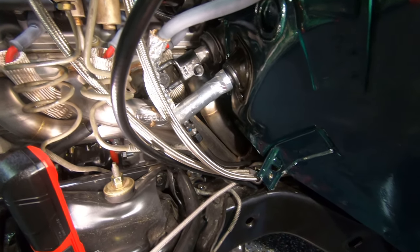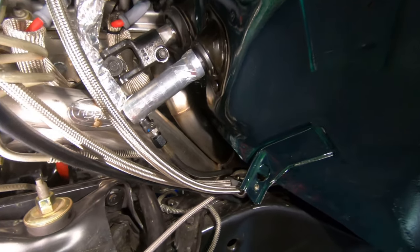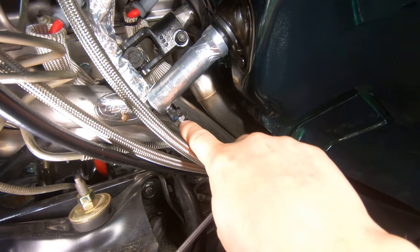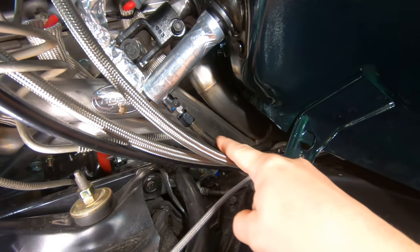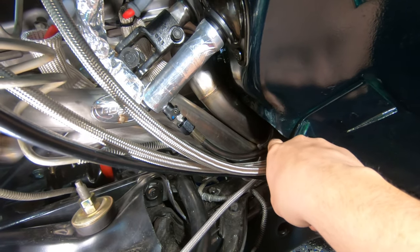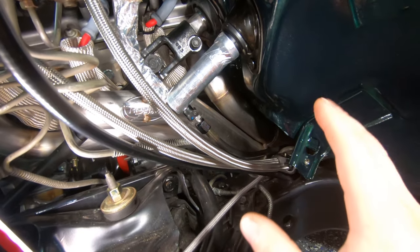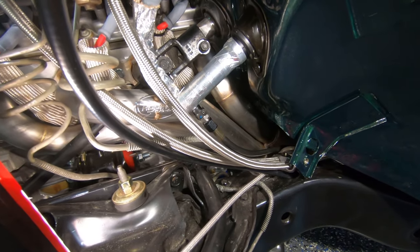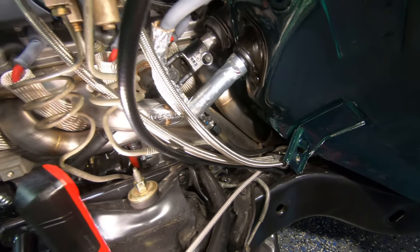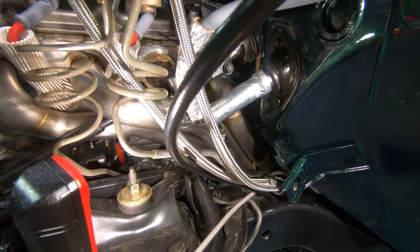It's in there. It's bled. We have a fully functional clutch now. I just want to show you the final product here. Master cylinder — you've got the special fitting there. This is the dash 4 AN inline. It runs down under the truck. I'll show you that in just a second. I went ahead and just bought a pre-made, either 30 or 36 inch line with a 90 already on the end of it — dash 4 on both ends — and I'll show you how I'm adapting it under the truck.